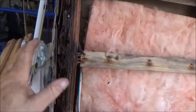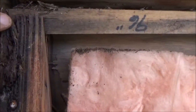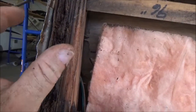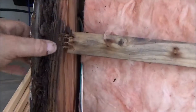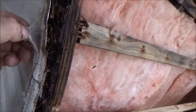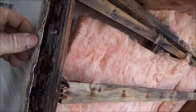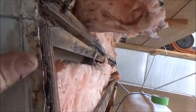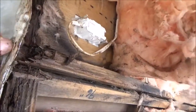This is the front passenger's corner - this is plywood. You see the grain right here - this is called plies. Each one of these is a ply. But when you put a screw in there, it just separates a ply - it really doesn't have any bonding power. There's that corner mold that comes over here and that's what needs to be sealed. If not, it'll rot that out and then you end up with this. That's why we really tell people to keep these sealed. Somebody just put silicone on there - that's why I do not like silicone. Nothing sticks to silicone. You'd swear that's sealed, but that whole thing will peel right off. Don't use silicone.